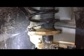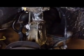You got to pull out the full strut to do it, so if your strut is bad, now's the time to replace it, right? So we at the very least have to order a pair of springs, probably some of our bump stop parts that came disconnected when I dropped the car there, so you can see the strut rod up there. As far as I know, it's original, so I might replace it anyway, because the car's got almost 160,000 miles on it now, so they got to be pretty close to end of life, and replace everything at once. And that's all for now.